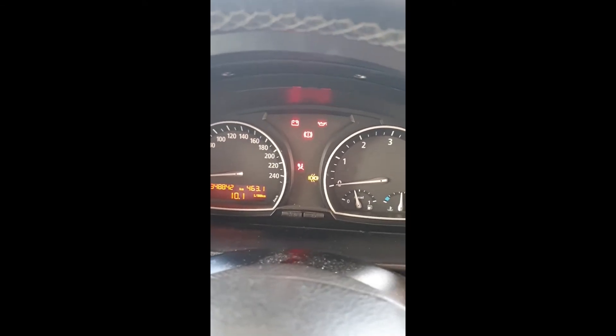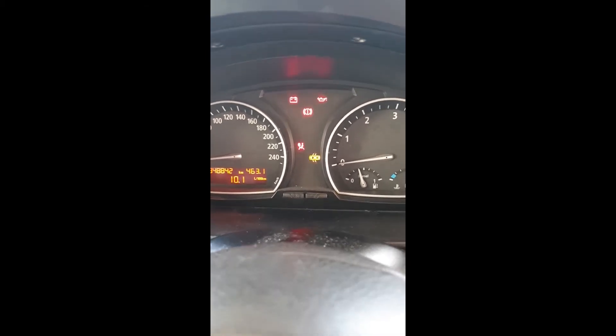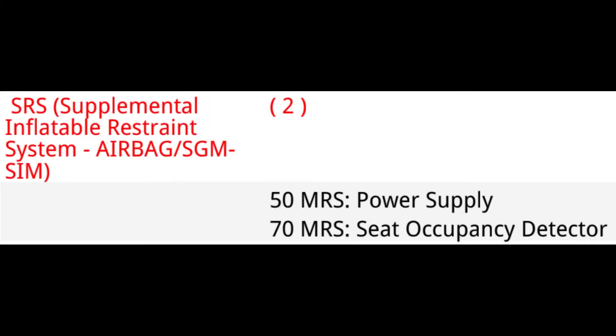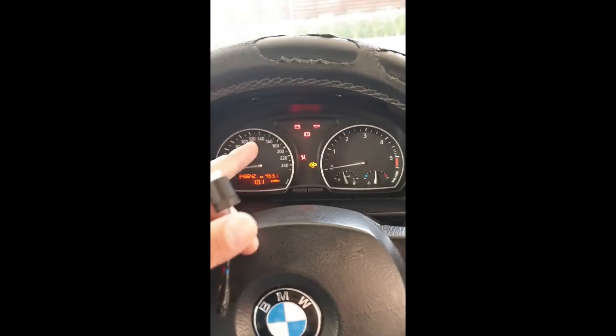Good afternoon guys, this is a quick video I wanted to put together because I've had real good success on YouTube and Google and I wanted to share my success. I bought this car four years ago with an airbag alarm, always thought one day I'd get to it. We found two codes: occupancy sensor failure and power failure for the occupancy — a 50 code and a 70 code — on a BMW X3 2005 two-litre diesel.